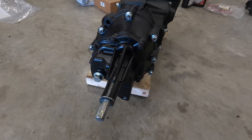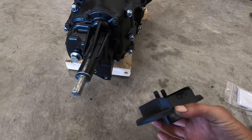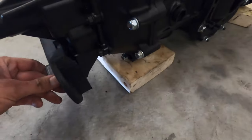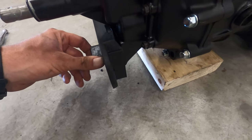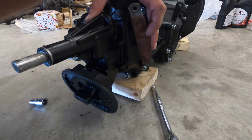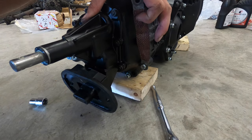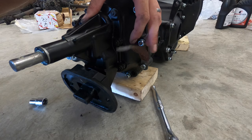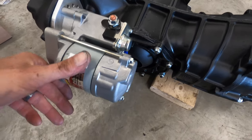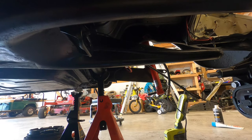My research told me 11 foot-pounds on those bolts. Now we're going to put our mount on — this goes on here with a washer and nut on that side as well. Don't forget to put your grounding strap on there. I don't have a new one right now so I just cleaned this one up temporarily. I'm going to install the one nut onto the starter to make it easier.